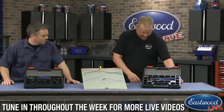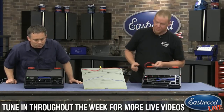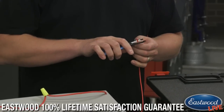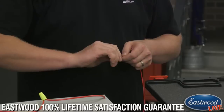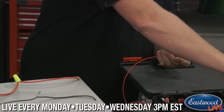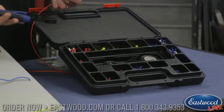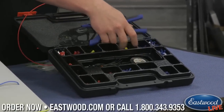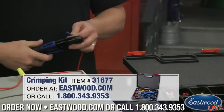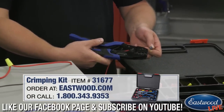So I've got my wire back here. Just dropped a couple of pieces — that's no good. So what we'll do here is use a regular piece of wire that you would use in the vehicle, similar to solderless connectors you're already using at home with the crimping set. Strip it back, grab your connector. This kit comes with your butt connector. It's a 550-piece kit with crimping pliers, wire ties, and electrical tape, so afterwards you can wrap it up and keep it as weather-tight as you can.